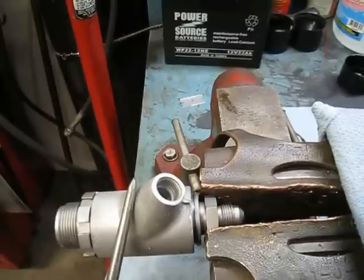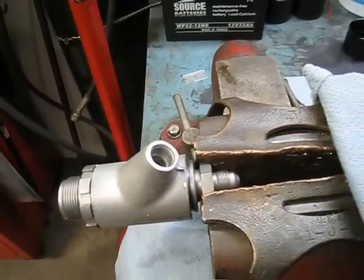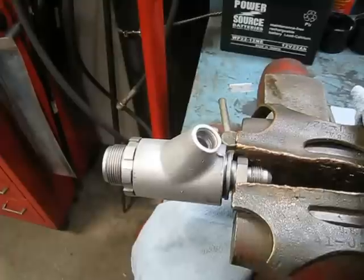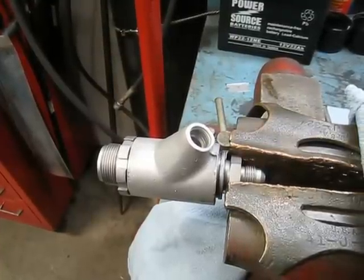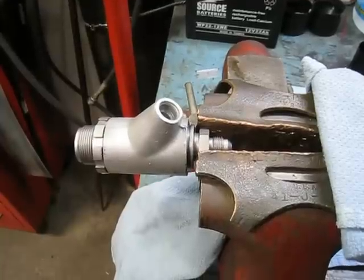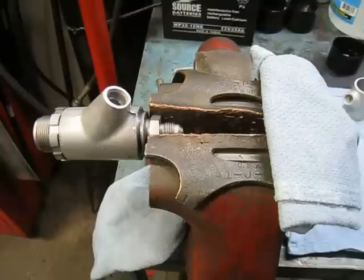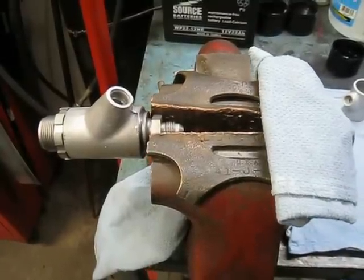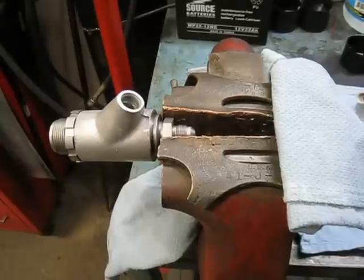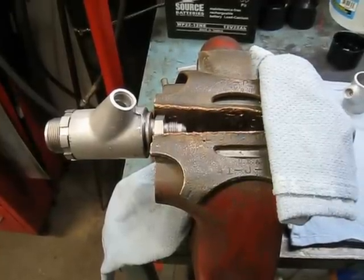Naturally you have to empty out the brake fluid and take the cover back off in order to put it back in the car using the proper tool and tightening it down. That is the finished product. If you were following the last two videos, especially the first one, you saw how badly this pump looked — it was extremely dirty. There was so much crud inside, what we call the chicken soup syndrome: old brake fluid that has absorbed so much moisture it's actually turned into a gel. You should never let your car go that far. It's very important to keep these hydraulic systems in good working order, and it doesn't cost a million dollars to do that — you just have to spend a little money, put a little extra time into the car, and find a good mechanic.